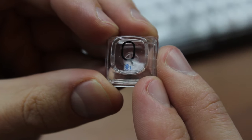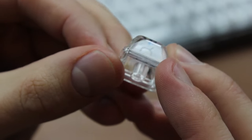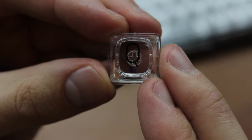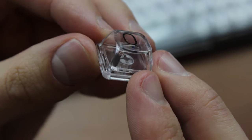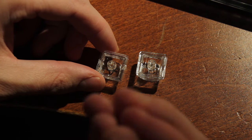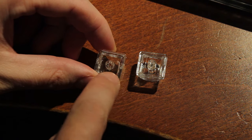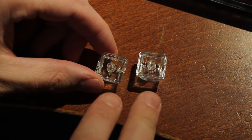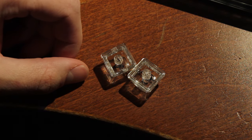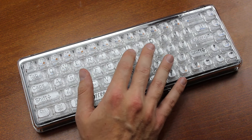As a side note, the keycaps are spherical-topped, and not only that, they're thick and hollow — the stems are fixed to a bottom piece to which the top of the keycap connects. This is a very clever idea, as connecting the stem to the top of the keycap would have given a very ugly light distribution through them, so that's a very nice touch. I had planned to open these keycaps up and stick something inside to show them off with the backlight shining through, which sounded like a cool idea. Unfortunately, they're impossible to open — there are little tabs on the underside, but I broke them off both keycaps and they still won't open, so I have no idea how you're supposed to. The hollowness and thickness also gives a very unique typing sound that's almost certainly the best aspect of the whole keyboard, in my opinion.